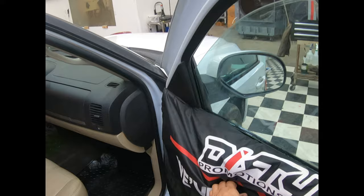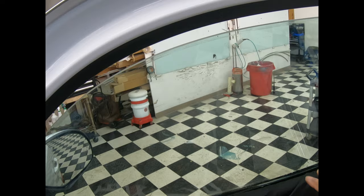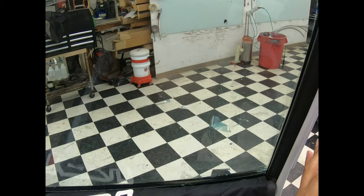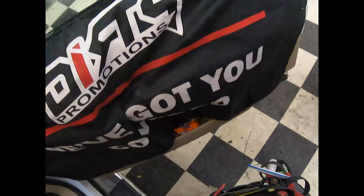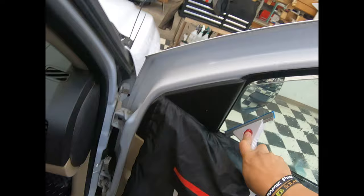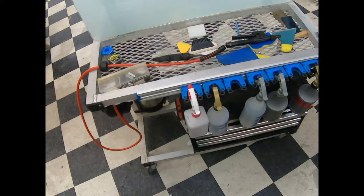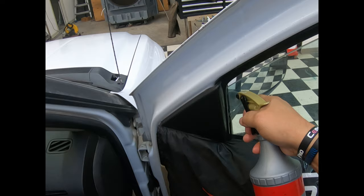Go ahead and do the lip real quick — always talk about that lip. Since we already cleaned the side, when I do my squeegeeing I don't want to push three tons of water boom into the wall because it's going to hit and come back. So we're going to do a different squeegee technique on this one. Do it from here — push everything this way and down, not in there, and continue doing this all the way down. On the side, I'm going to use a slip solution that I have to use with this type of film because this type of film has very aggressive adhesive. I hate it — it sticks, and when it starts sticking you're going to get this little glue smear.